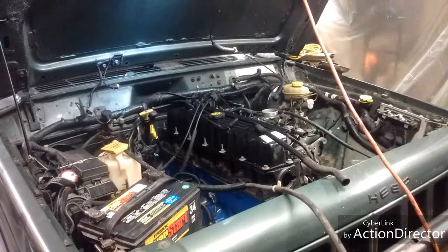Torch here. I got a lot of stuff back on but before I start it I want to make sure this thing is spinning freely — I don't have the spark plugs in yet. I want to make sure everything's spinning freely because so far I could do everything by hand, but after putting on a few more pieces I want to make sure she's still free, so here goes a little spin. I got oil in it but no spark plugs, so nothing's really hooked up that it'll start. I just want to crank it over and make sure she's free.